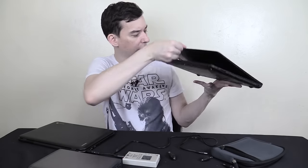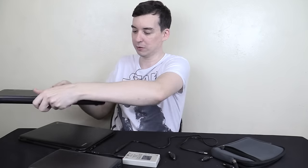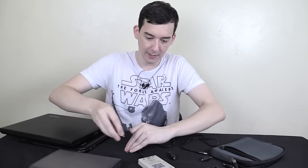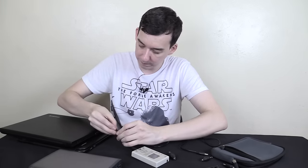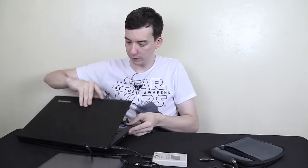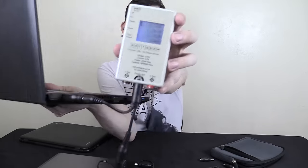Here's another laptop I borrowed — a Lenovo G40. This one has that common square/rectangle block connector. I'll disconnect the Chromebook and run the Lenovo through my power meter to measure how much power is going in. It looks like this one is consuming around 21 watts — though that may be because the battery is nearly full, as laptops consume less power near the end of a charge cycle. When I open it up and turn it on, it increases to around 30 watts, because now it's not only charging the battery but also powering the laptop — a basic demonstration that it really can charge laptops.